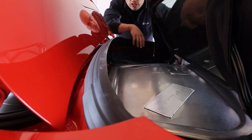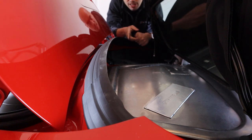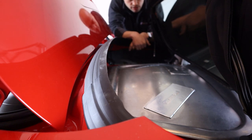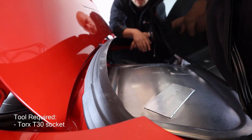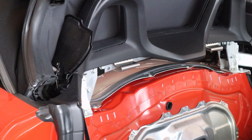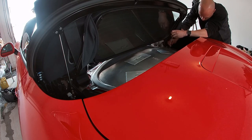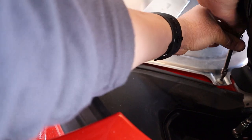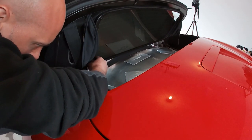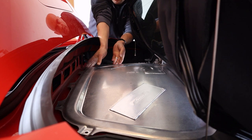The first two covers are quite easy to remove — it's just a case of untucking, pulling and releasing. This metal plate is a little bit more tricky, because it's metal and also has some sharp edges that could scratch your paintwork. So you have to be careful not to scratch the area in here. The first thing we need is the T30 bit on our screwdriver to release all of these bolts — they're all the way around. The reason we had to take off the carpet in the interior was to access a few of those bolts at the front. We're going to pull it up from this side and pull it out this way, being very careful not to scratch anything.